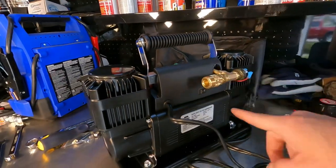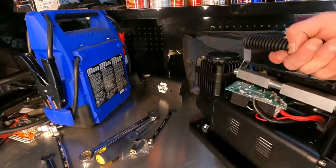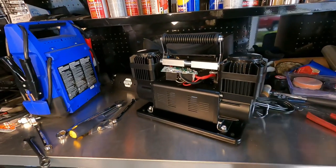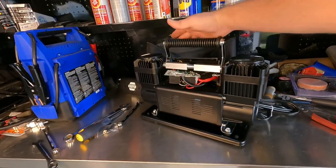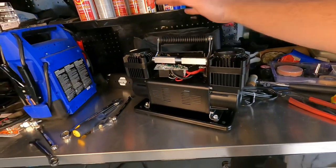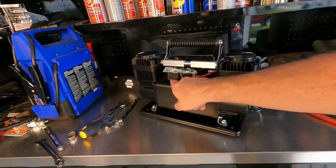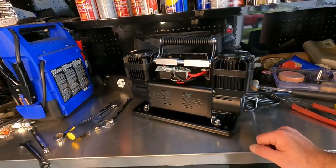The way I tested it is I took it out to my vehicle, connected positive to positive, negative to negative, turned on the switch, and it should just run for like a second because it's gonna reach that shutoff safety on your pressure switch and turn off. If it doesn't turn off after like a second, turn it off — you probably have it wired incorrectly. That's when you need to switch it on the board, and then you should be good to go.